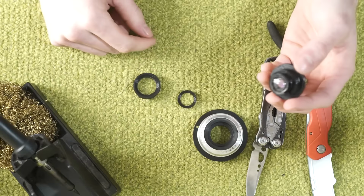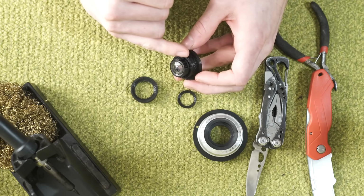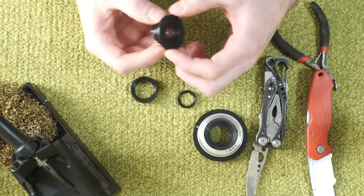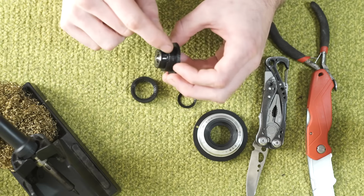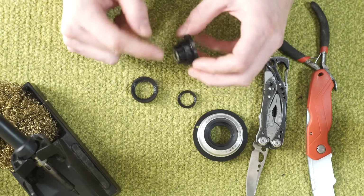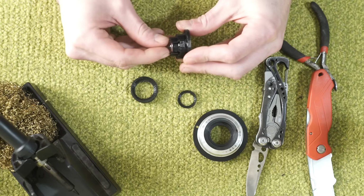So now we have a few more components here, and these additional components essentially stem from the fact that we have a complicated object inside here, i.e. this flange sits on front and keeps the lens from moving forward. The piece inside here will keep it from moving backwards to a certain extent, but remember that was all a rough measure. So the exact measure is this back piece of plastic here to this back of the printed section.